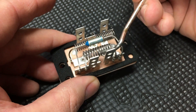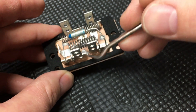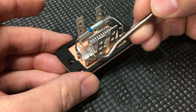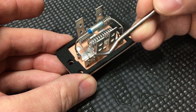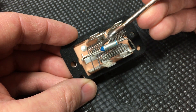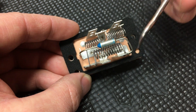After it goes through the thermal fuse, it comes down and around to right here — this is just a jumper up and over to our first resistor. Once it goes through that first resistor, we have a lower voltage on this side, so at that point we can output that down to another one of our terminals — that would be the medium high. Now if you want medium low, which is number two on your dial, we need to go through another resistor, so the current keeps coming through, jumps over to this resistor, flows through it, drops more voltage, and then there's another output.